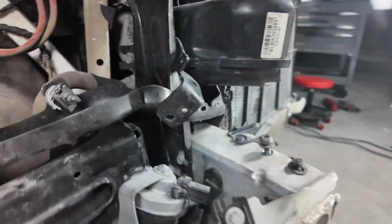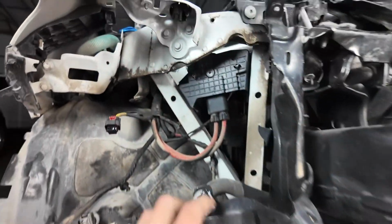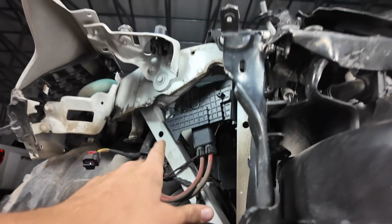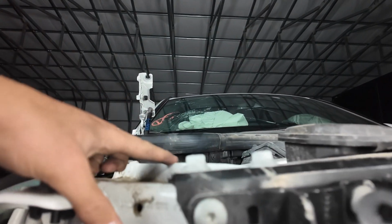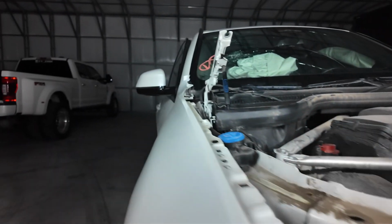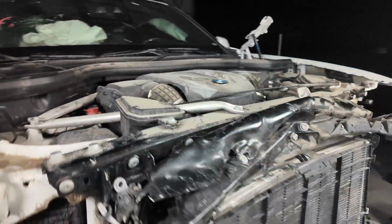But besides that, another problem with the chassis leg being twisted and bent is that it's pushing this frame, which holds the entire fender, because that kind of twists the entire fender, which you can see up here is that it kind of tilts down to here, and which is the main reason why this fender is pushed back and overlaps with the door panel. But besides that, looks way better already.